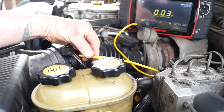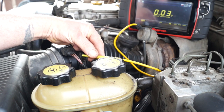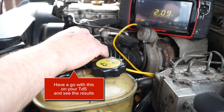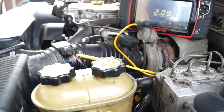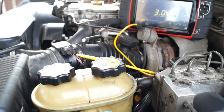There is actually a lot more to the mass airflow, but first I want to get you used to how it works. By probing it from the back, you could use a paper clip with your multimeter, and when you rev the engine you'll see the voltage will actually go up. This is how you do a basic check to confirm your mass airflow is actually working.